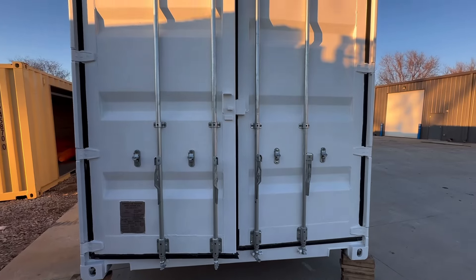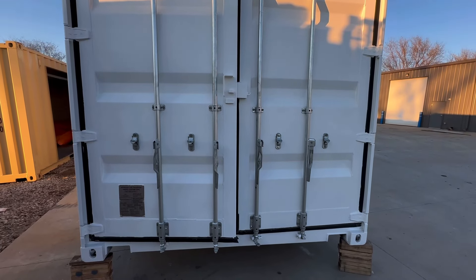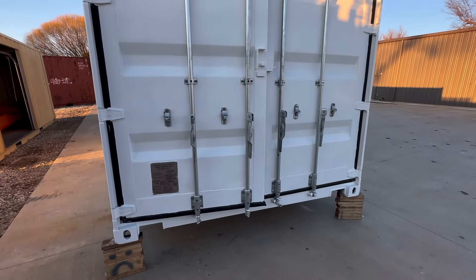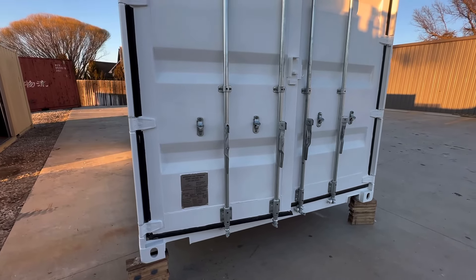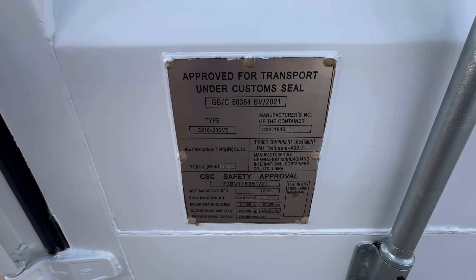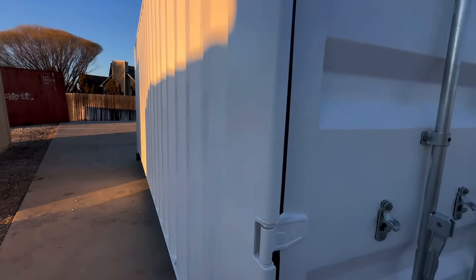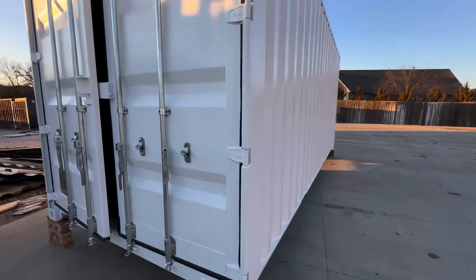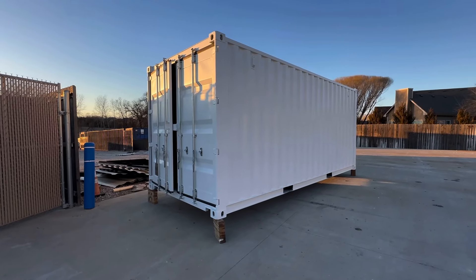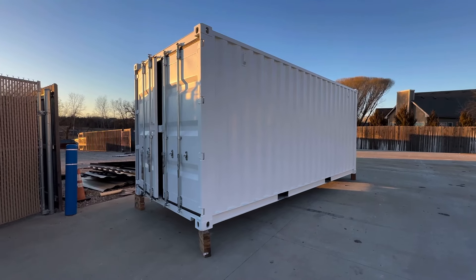All in all you're probably using two gallons of paint — it's pretty much a satin sheen. Labor, with peeling decals, is probably about six to seven hours total, depending on how fast you are. One more thing: you could paint over the decals, but that's like painting the handles — it's just terrible quality and looks like trash. You can see here we masked off even the sealant on the tag, so this looks pretty much factory. This is RAL 9003 Signal White — the customer had to have it, it's very hard to find, so in this case paint made sense.